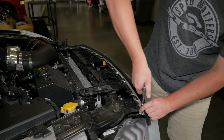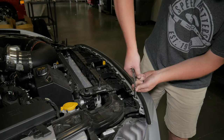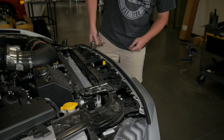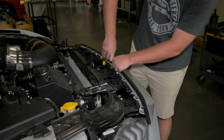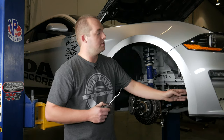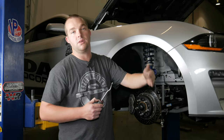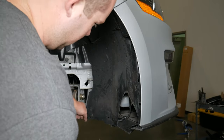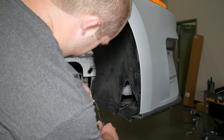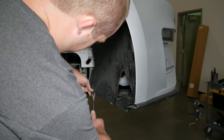The ones on either end are the smaller 5.5mm ones. Grab your panel removal tool and get these plastic push pins out so you can pull the plastic wheel well back and access the bumper bracket to get it unbolted and pull it away from the car. There's a gaping hole here on the Silver Bullet — your car probably doesn't have that — it's because things are rubbing a little bit, but thankfully the wheel and tire combination with Built Specialties is all figured out.